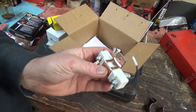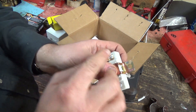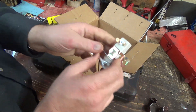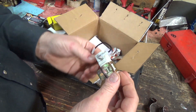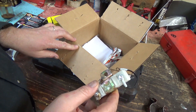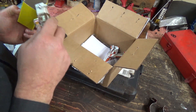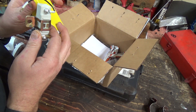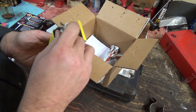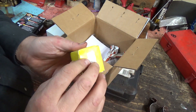That'll just mount to a bolt. Then you run one of these from your ignition wire from the key switch through the resistor and then down to your coil. They say it doesn't matter which way it goes. A lot of people mount these right down by the coil but I think that looks kind of crappy. I'd rather just see one wire coming down. That's probably what I'll end up doing. It's like a ceramic thing — ceramics disperses the heat.